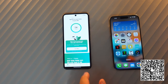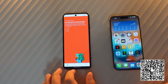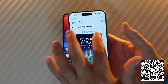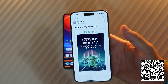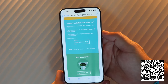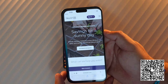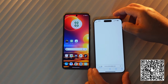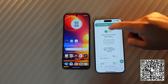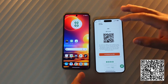One thing you could do — it's not required but recommended — is download the Mint Mobile app so you have it installed and ready to go. You're also going to need an activation email that tells you your eSIM is ready and your service has been activated. Scroll down in that email and look for 'Install My eSIM.' Click that link and it will take you right to Mint Mobile's page. You'll see iOS and Android instructions, but it doesn't matter which you select if you're just going to scan the QR code — the QR code is the same for both.